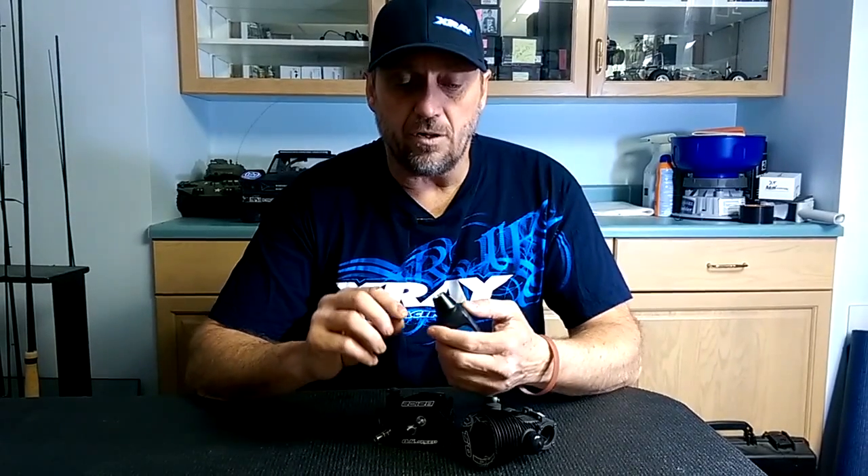Some of the things I see a lot of people doing is using temp guns that are really dirty inside the lens. With all the dust and dirt in there, it'll actually read your engine as a lot cooler than it actually is. If you can take a Q-tip or the end of a paper towel and clean that lens, it'll make the temp gun read much more accurately.